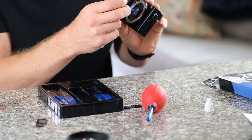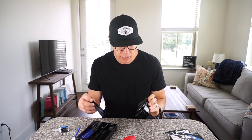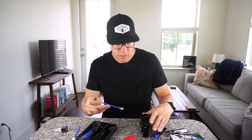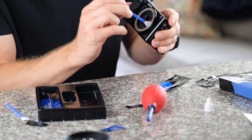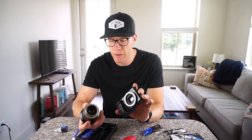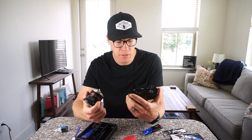This is going to get the swab nice and wet. Take the least wet side — opposite from where you applied the drops — and apply a little pressure, going from left to right across the sensor. If you have any remaining liquid on the sensor, take another fresh swab and do the exact same motion just to get all that liquid off. And there you have a nice, beautiful, clean sensor — until next time out in the field shooting in sand and rain.